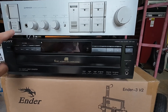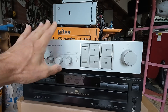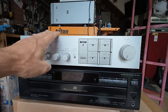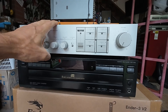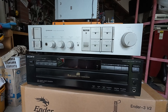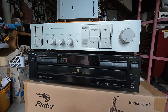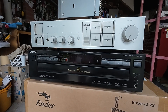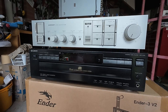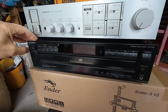So what do we got? We've got a Sony CDP C325 - I've never seen one of these before - a 5-disc carousel. This is the Pioneer A30 stereo amplifier that he said doesn't work, but he did say if you drop it, it works for a while, which suggests it's got a dry joint. That's a project for another day. For this one I'll power it up and see if we can get it fixed - hopefully it's just a belt. He basically said the drawer doesn't open.